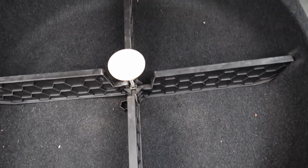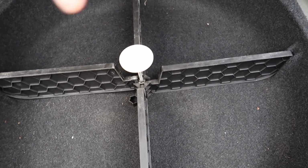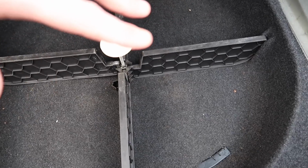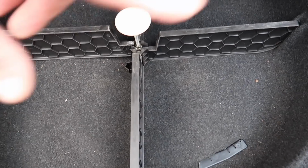And if it is down here, pre-2006 cars, 2003 to 2005, will have it down there. Any cars past 2005 will have the KGM module, which is built in. You will not have the micro power module here if your car is above 2005. So please do not go looking for something that you won't have. If your car is above 2005, you will not have the micro power module down here.